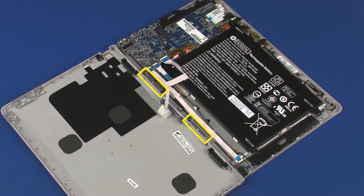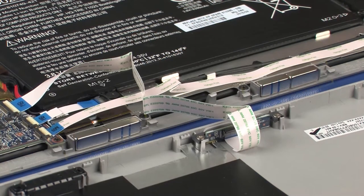There are four docking magnets, two pairs of two, seated on either side of the pogo pin connector of the display panel assembly. A pair comprises a magnet marked with two blue lines and a magnet with no line markings. The two blue lines on the magnet indicate magnetic north.